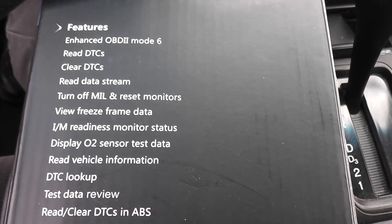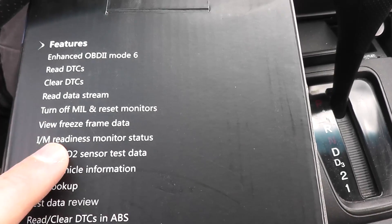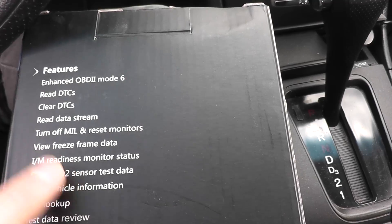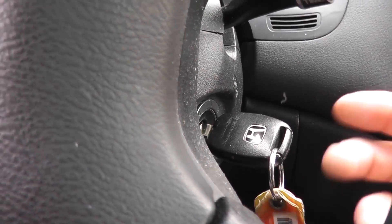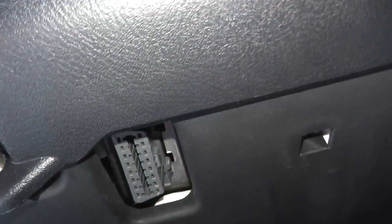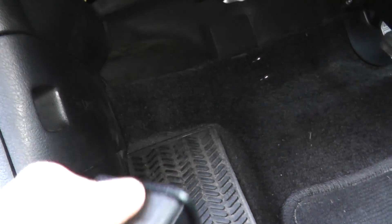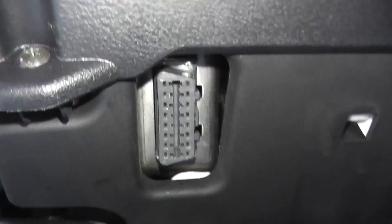For those of you that live in a state that's incredibly strict with emissions — New York, New Jersey, California — I'll talk more about this readiness monitor status, which is very important. The first step is just turning the ignition key to the on position. No need to start the vehicle, just turn it to the on position. Looking underneath the dashboard, you have a connector — it's the same size for all 1996 and later vehicles. You take the end of the scan tool and plug it into this port.